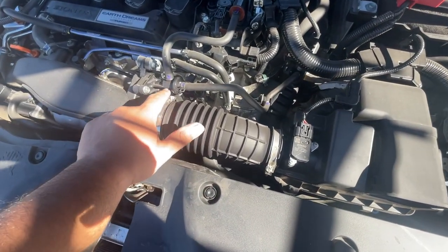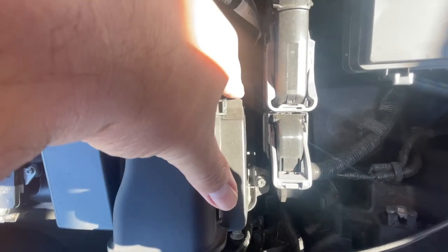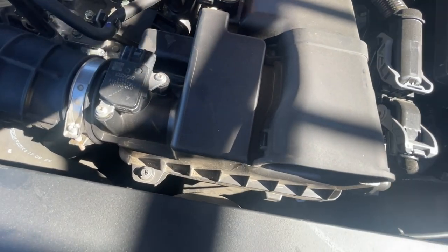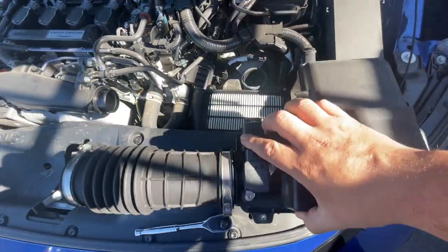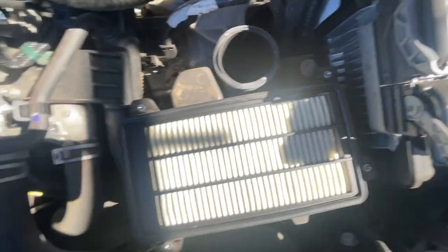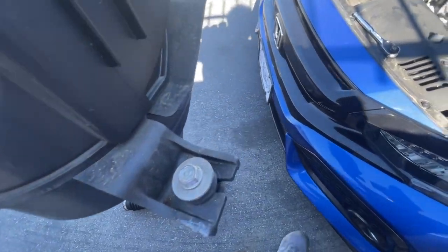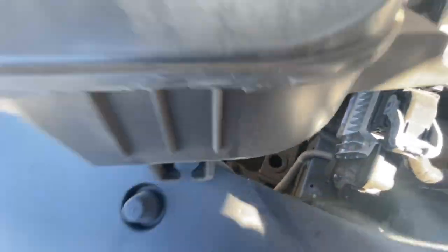The first step is really simple. You'll remove six screws — you can use a Phillips screwdriver for all of them. Don't forget to disconnect your sensor. Once that's out, leave the sensor in place until everything else is removed. Then this piece just comes off — don't forget that piece right there. Take that out, then this next piece comes off, and then the whole thing just pops out. The cylinder cup was basically suctioned in, so you have to wiggle it all out, but that's it.